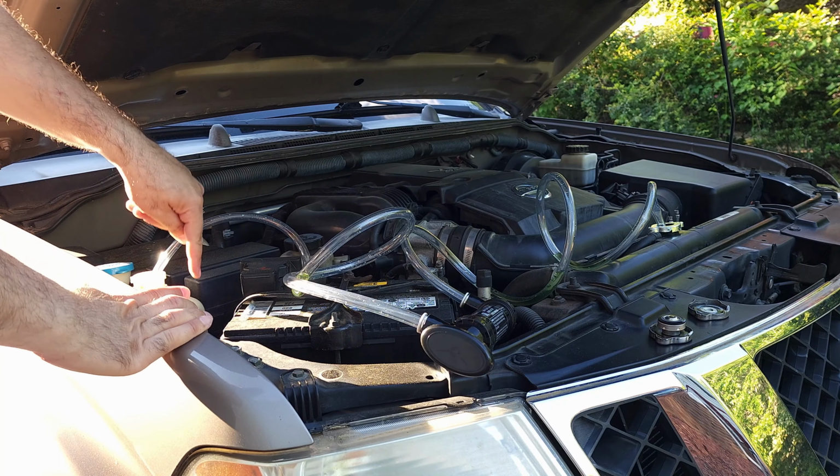Okay, that's done. And now we will turn the engine on and leave it run until it's operating temperature, then use the heater for 10 minutes. And I'm gonna put the cap on. Cap on the reservoir, and then the cap back on the radiator. Oh, I almost forgot. I need to add the distilled water. Hold on.